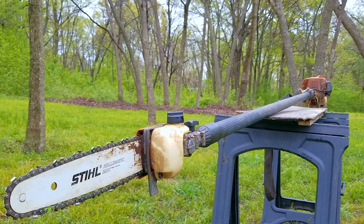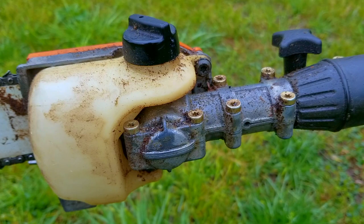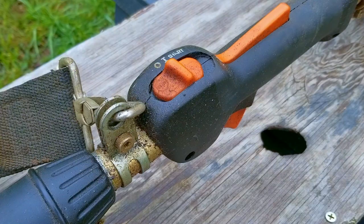What's up everyone and thank you for stopping by. Today's project is this pole saw from Stihl and the problem is that it won't start. Now the biggest reason why it won't start is that they didn't take the steps they needed to for long-term storage. It does run for a bit after putting fuel into the carb's throat, so at least we know it starts and runs. So more than likely, the problem is just the carburetor. But before we take a look at this carb and service it, I want to give it a good cleaning so we don't get dirt in places where it's not supposed to be, like in the fuel tank or in the carb.